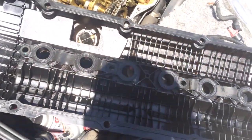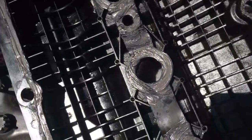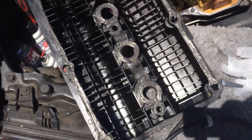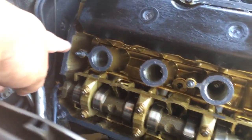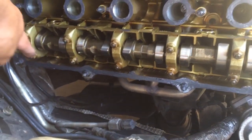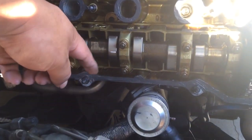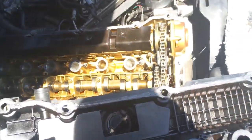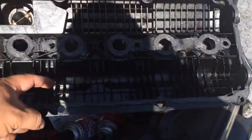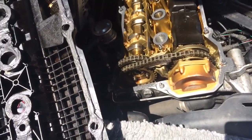Here's how it looks with the silicone on the gasket. You don't need to put too much, but make sure you put a lot around the edges where it's leaking — especially the bottom edge. I put more silicone here because most of the oil is leaning on this side of the engine block, so I want extra protection to stop oil from shooting through there.